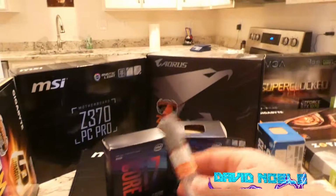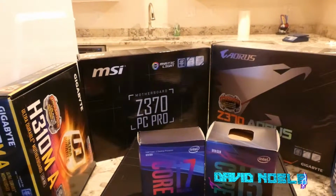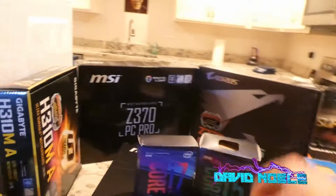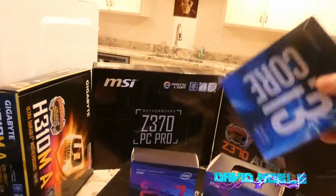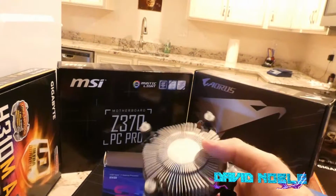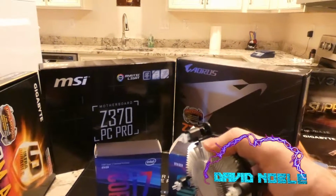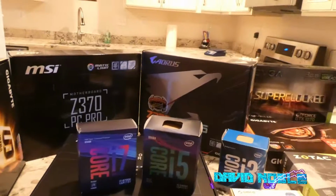Now also, don't forget your thermal paste. Alright, you are going to need this doing your new build. A lot of times the processors come in and they won't have it on them, but if you get one that has a CPU fan, like this came with a CPU fan, and not that we're really talking about this one, but you can hear the fan in there, such as this Intel fan right here, this will actually have the paste on it, so you won't need it. But if you have to take it out because you realized, oh, I've got to update my BIOS with an 8th gen, then you will be wiping that off and reapplying.